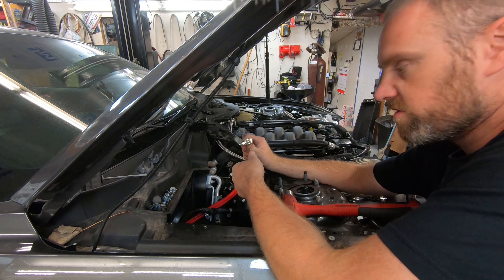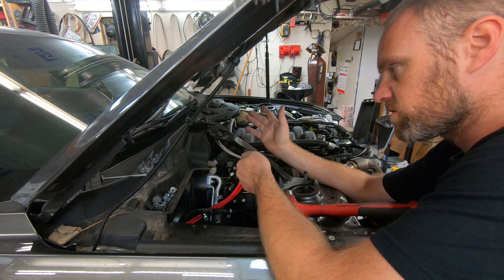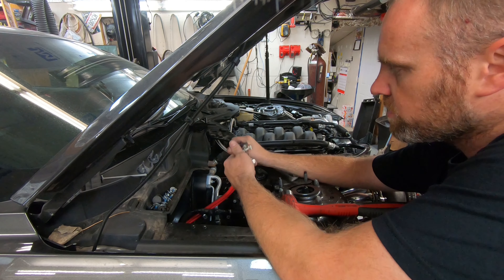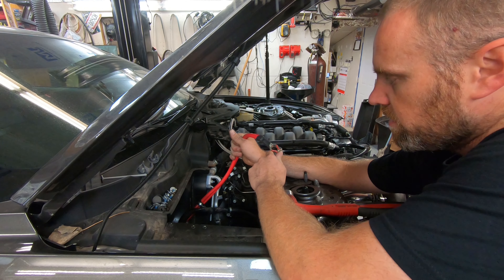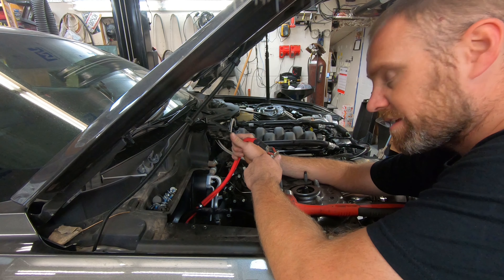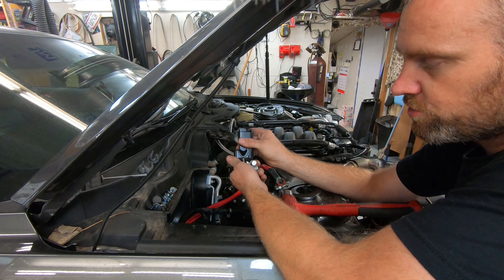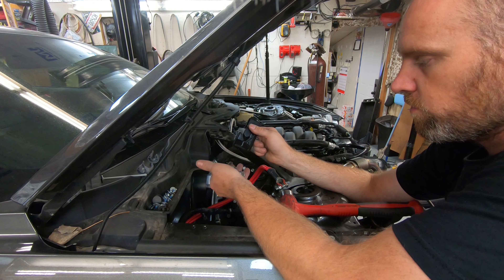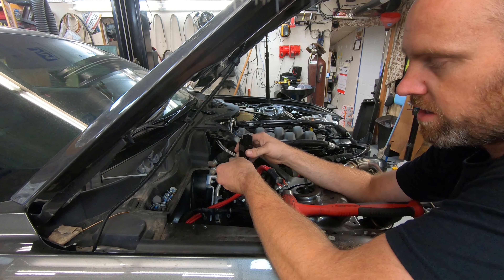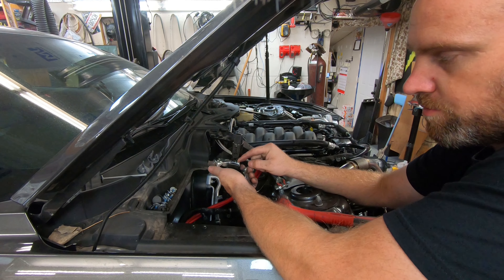I've got to get some steering components on because I need to pull the car out for a bit and do some cleaning — I'll obviously need the steering functional for that. Now, battery terminals: the On3 system had a little eyelet and a marine style battery terminal. Those are okay, but I prefer a different style. This one here I actually have soldered into place — it's a very nice crimp terminal design, but I solder them rather than just crimp. There's a special tool for it, and I'll throw a link in the description for the tool and terminals.